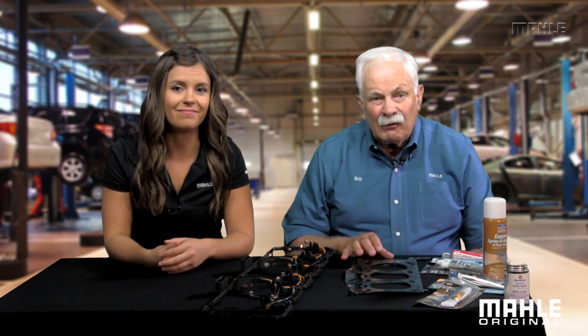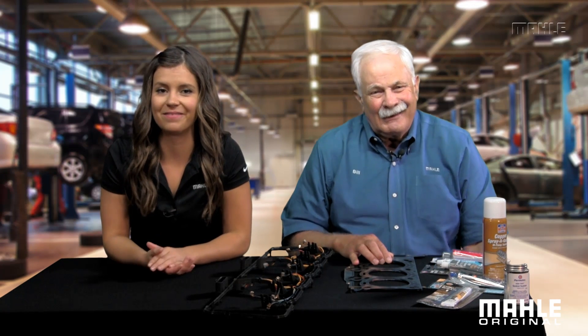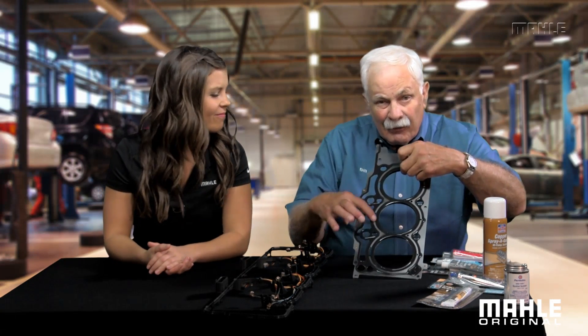Remember, Alex, when we talked about high-tech silk screen coatings applied to MLS gaskets? You mean like the one you have in front of you right there, the one I did the thumbnail test on? Yes, I remember that. Well, Alex, we see a number of warranty claims where these gaskets have been coated with sealers like copper coat. What we found out was the chemical sealers had attacked the high-tech coating and caused it to dissolve. That coating is on there primarily for good fluid seal, and when it dissolved, the gaskets leaked. Let me guess — claim denied, right? Yep.